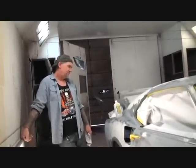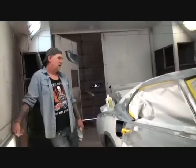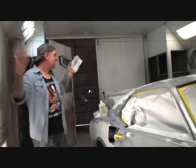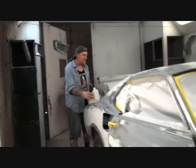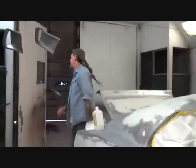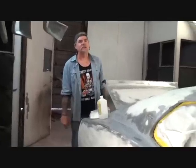When you're using the alcohol in this particular situation, can you over-wipe? Watch this — look, it's dry already. It dries immediately. Wax and grease remover in this weather would take 10 or 15 minutes to dry properly. You don't have to worry about that with alcohol. We're done — thank you very much. If you didn't learn anything from that, you learned one thing: your wife can be a jerk sometimes.